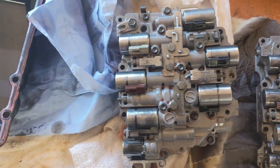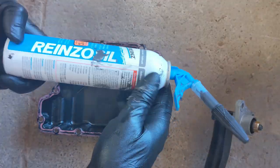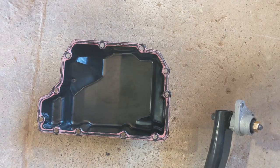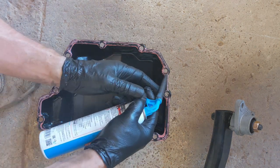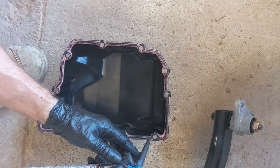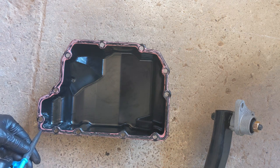You can see that the new one looks a lot better. This is the liquid gasket I am using. You have to make sure the contact surfaces are cleaned before applying it to both the cover and the gearbox. You can probably use a different one — I just use this because it is really easy to apply. Putting it back together is really just the opposite of taking it apart.